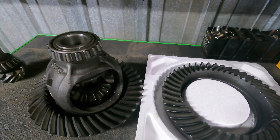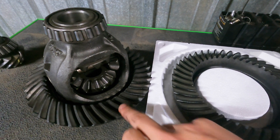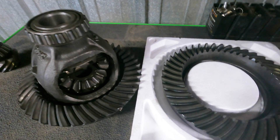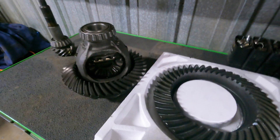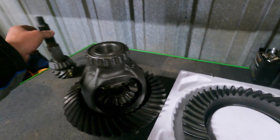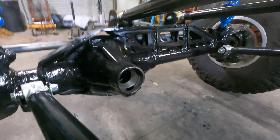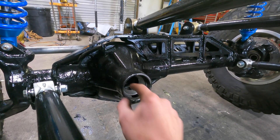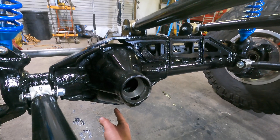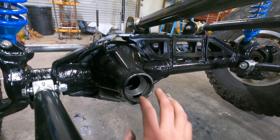While we are looking at our rings and pinions, this is a great time to talk about reverse-cut gearing. Super Duty Dana 60s are a high-pinion reverse-cut. The 14-bolt is a standard regular-cut. If you look at the rings, they run completely opposite of each other. That is because with reverse-cut gearing the pinion is actually on top, opposed to in the center or below. On our Super Duty axle, the pinion is on top of the ring gear — that is reverse-cut gearing. If the pinion comes in on the bottom, it's standard-cut gearing.